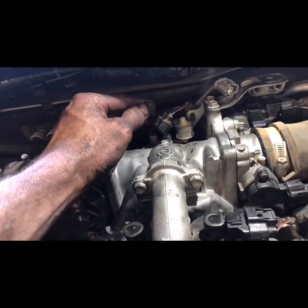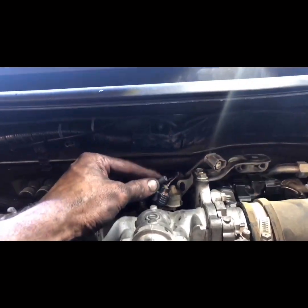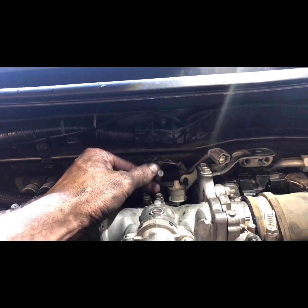Just a quick tip when you go to put the intercooler back on - there is a suction line just there that everybody forgets about. There's another one that runs down to the bottom that goes into the bottom of that housing - don't forget to put that suction line back on, otherwise it'll only get about 90 k's an hour. There's also a little sensor on the back of the intercooler that's got a plug - don't forget about it. Subscribe to my channel guys and check out some of the other videos.